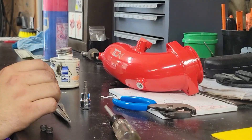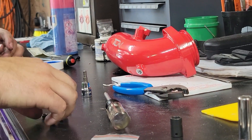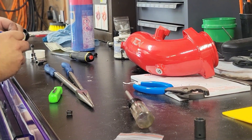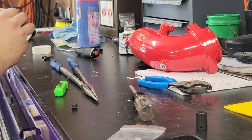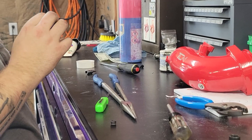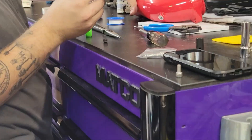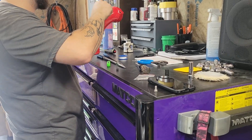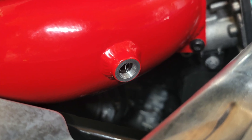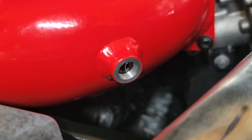Now here's a couple of things. This piping has some bungs on it designed for sensors or nitrous, but they're not very good — they're not NPT, they're just standard threading, so they're actually kind of annoying. We had to use thread tape and some loctite, and we wrapped up the little allens that came with it, which aren't very deep in the first place. This is one of the cons to this piping. Look at how shallow that allen goes in there, and again because it's not NPT it doesn't really tighten — you just gotta get it in there, which is really stupid.